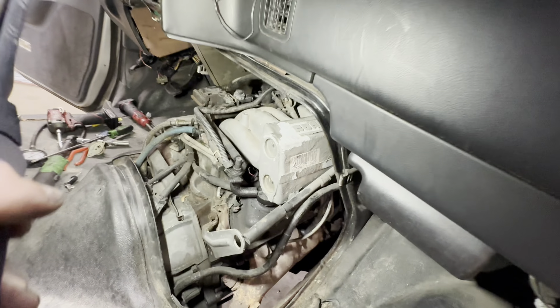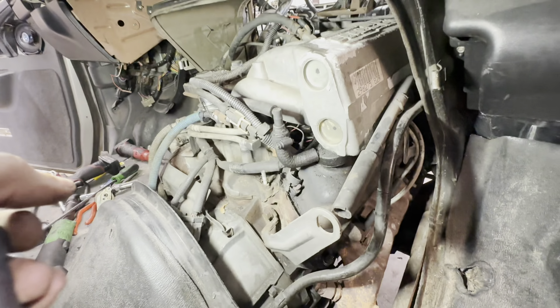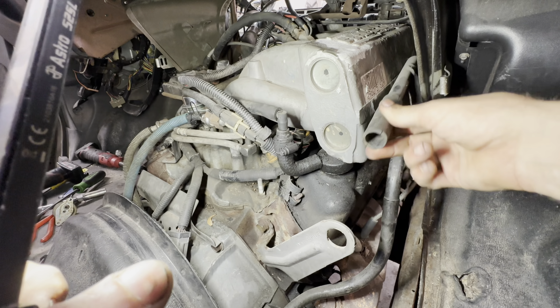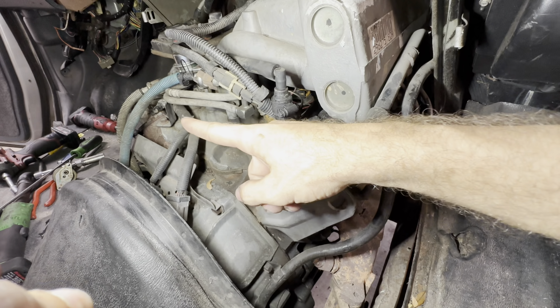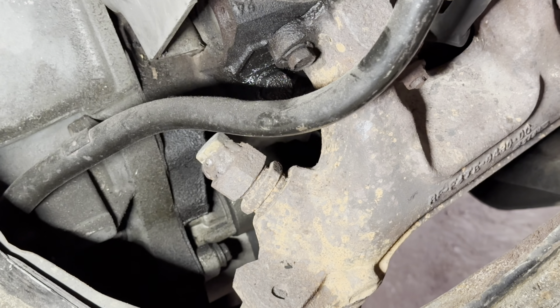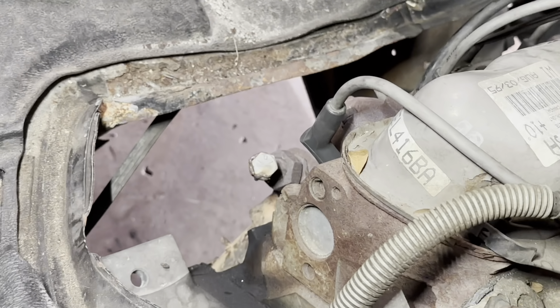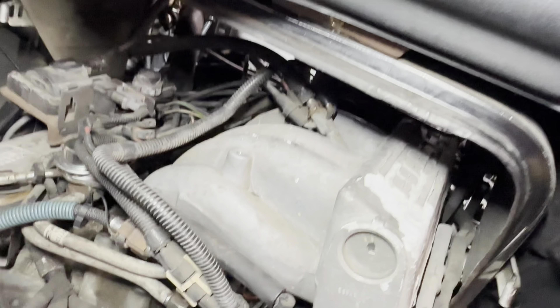That's not the problem — it is a problem with this engine, but it is not the problem. I'm slowly starting to figure out and narrow down what the issue is, or what it isn't rather. This pipe right here goes to the air injection pump, which is an emissions device. Off of that air injection pump there's supposed to be a crossover that goes over to the other side exhaust manifold — with a fitting on the manifold where a bolt's been welded in. That's not the problem, just letting you know what I found.